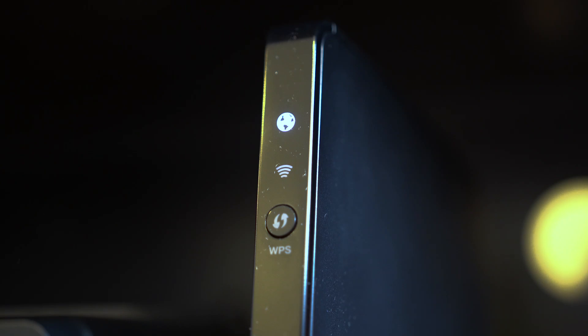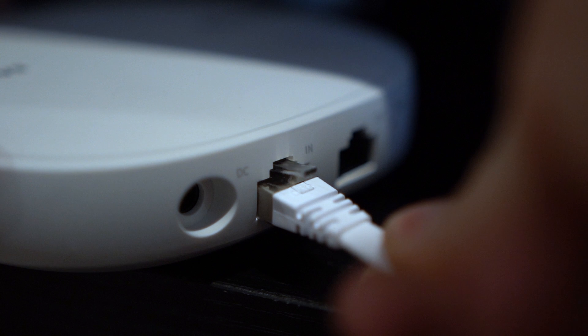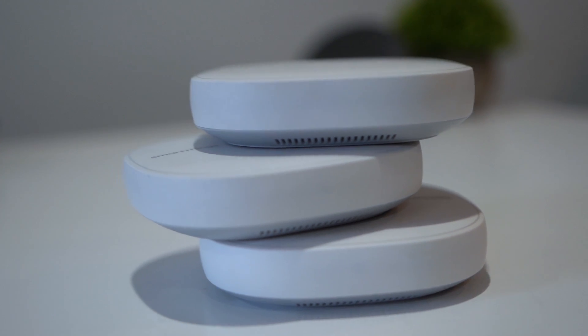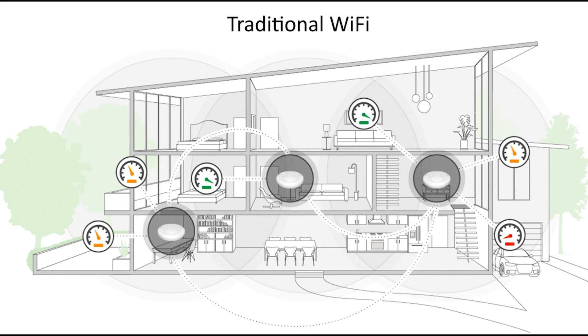Normally your Wi-Fi network in your home works by having a Wi-Fi router sitting in one spot connected to your modem, or it might be a modem-router combo in one, and it projects a Wi-Fi signal within a certain radius around itself that allows your devices to connect to each other or through the modem and to the internet. Now in a Wi-Fi mesh network, however, there is one main router that plugs into your internet modem in the same way a traditional one does. But then there are also other hubs that are identical to the main router hub that you can place throughout the house, generally on the edge of the original one's range, to then increase the range of the network. It essentially does this by having a super fast connection between each of the satellite hubs and the main hub plugged into the modem.